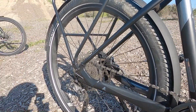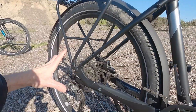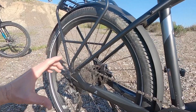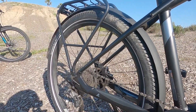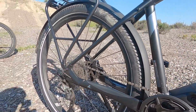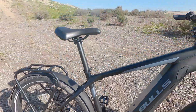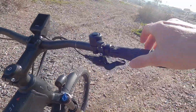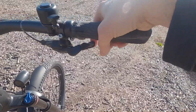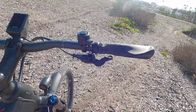There's a decent spread here — this is 11 to 46 tooth, so you see that really large sprocket in the back. That's for starting and climbing. It makes a lot of sense especially since this is a larger chain ring — it kind of offsets that and makes it easier to pedal. I also really like the shifters — you've got a two-way high lever you can push or pull, and a multi-shift low lever. I just dropped three gears right there.